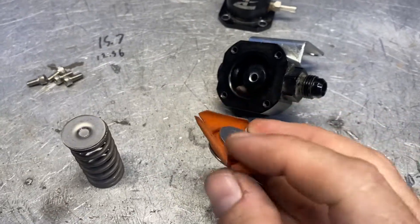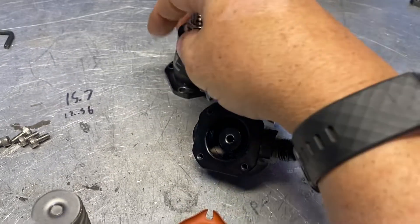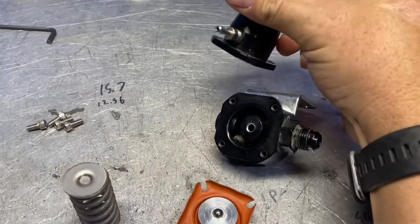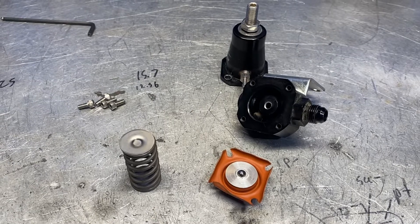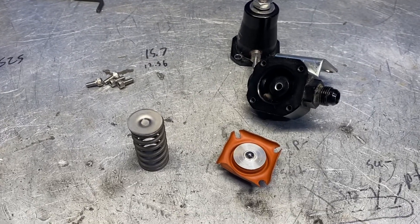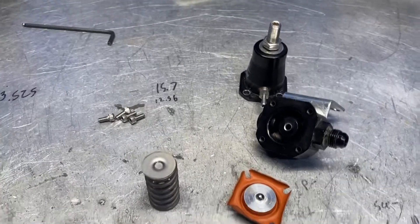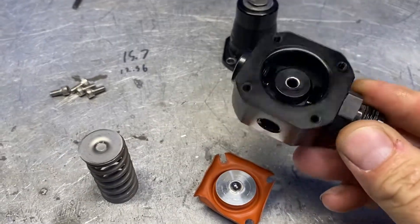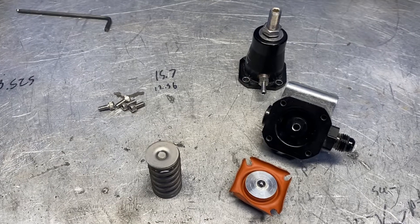Reason number three is this design with a diaphragm that is the only barrier between the fuel and your pressure port or vacuum port — if something goes wrong with this diaphragm, if it gets a tear in it, all of a sudden you have pressurized fuel going to this vacuum port. If you're lucky, it will kill the car because it'll go so rich all of a sudden that it'll just shut down. If you're not lucky, you'll hydro lock a cylinder because that's quite a bit of fuel coming out of there, and again, that will cost you your motor. It's one of those things that might happen at the worst possible time — like maybe you're drag racing somebody and you're not paying attention to the vehicle. This thing fails and all of a sudden you've lost your motor. Bad design — poor, cheap quality — you're paying big money for the name and not getting a quality product. That's why I wanted to do this video.